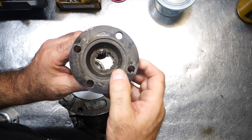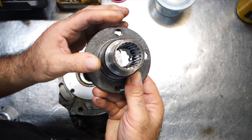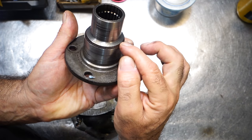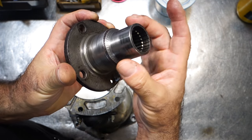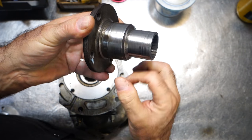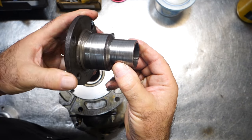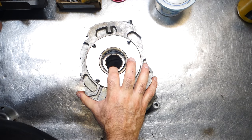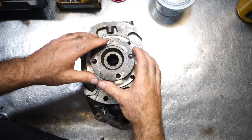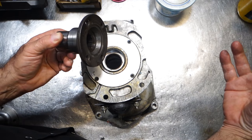Here's a better look at the yoke. You can see the original 10-spline yoke from the Jaguar on one side and the 16-spline yoke I used from the Mopar on the other. You can see the fillet weld done all around, cleaned up so it wouldn't cut up the seal. This whole thing ran nicely — there are no big grooves in it and the bushing wasn't worn; it still fit tight. Bolt-on yokes are good because they don't move around, but the problem is you have to have a slip yoke in the drive shaft, and I never really liked having outboard weight on the transmission.